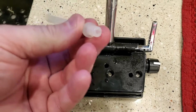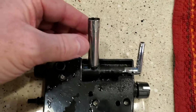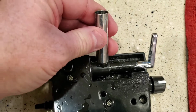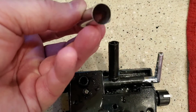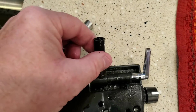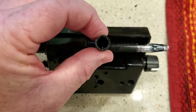You can take this hose off, and you can clean that hose really well. I wouldn't put this in the dishwasher, just clean this by hand. Now this little, be careful, this can be hot, but this metal thing you just quarter turn it and it's going to slide off. And you can take a brush and clean inside there. Sometimes you get some milk in there that's kind of hard to get out. And same with this opening right here, that's where the milk comes out. Sometimes you get some milk in there that you can't get out and you just got to get a little brush in there.